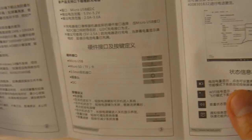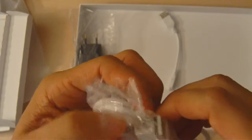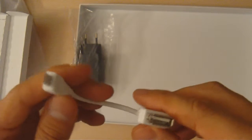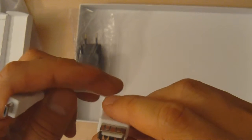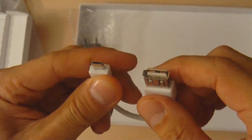Here it looks like a T-Class warranty registration of some sort. Here's another manual — it seems to list the specs: 5 to 5.2 volts, 2 to 3 amps, referring to the AC adapter. Here is the power cable with USB on one side and micro USB on the other to connect the AC adapter to the tablet. And here's the on-the-go cable: one side is micro USB and the other is a female USB connector, so you can connect USB drives or other USB devices to the tablet — which is great.